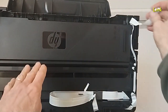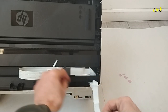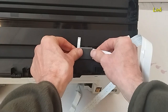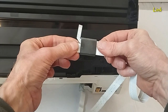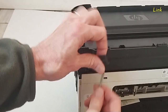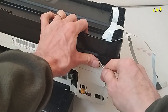Slide the side panel and remove it. Remove the flat cables of the scanner unit. This is the position of this part. Remove the other side panel and remove it. Remove the two blocks of the upper cover — one of them is here, another one is here.